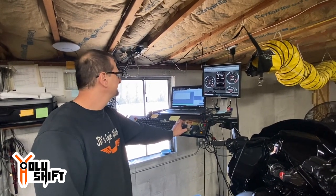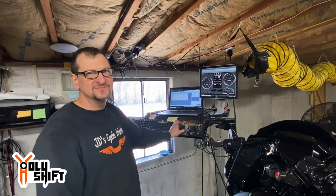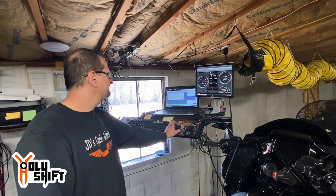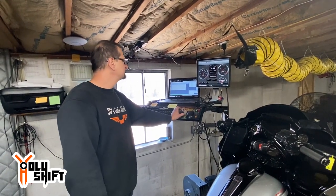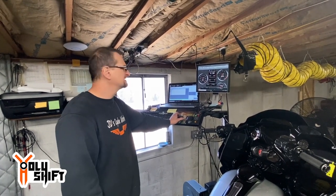Then you see how it shakes down, and if you want to make adjustments or changes, you go from there. But I think it's going to be good. Going to be good plus. It'll be very, very good. We kept our cam that we like to use, which is a mild cam. It's a nice cam. It's not too aggressive on the valve train. That helps things live longer.